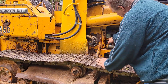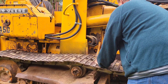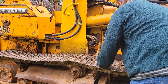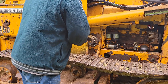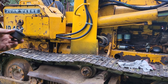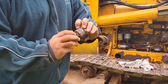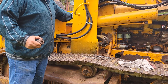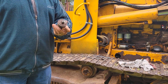The gauge is right here underneath this fuel filter, between the fuel filter and the starter solenoid. I'm going to go ahead and take off the starter cable here to improve a little bit of access — I've got the fuel lines a little bit in the way. I got the old sending unit out. Suffice to say, I don't think it was doing a whole lot of anything. It was a mess — the wire was long gone. I found it was actually easier to go in from the control side; I could reach down behind the brake pedal.